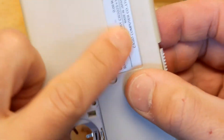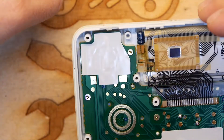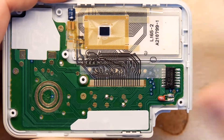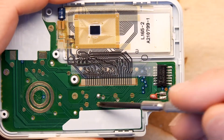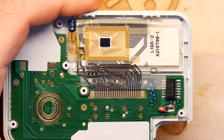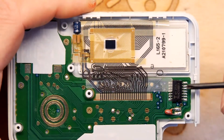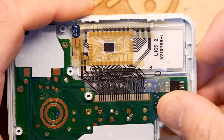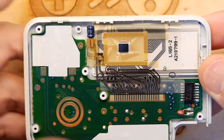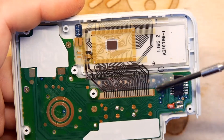In fact, look - you can see the badge there. Behind the badge are these holes, and clearly they actually marry up with these pads here because they're either test pins or they just sort of program something in. You can see here: one, two, three, four, five, six, B, A - something to do with mode or temperature type probe elements. Very clever. And there's a chip here - it says T9126H. And then there's a crystal and a capacitor. I kind of think that's probably a timing circuit. On the other side of the board is the keyboard membrane. Just possibly that could be a temperature device - like a thermistor type thing.